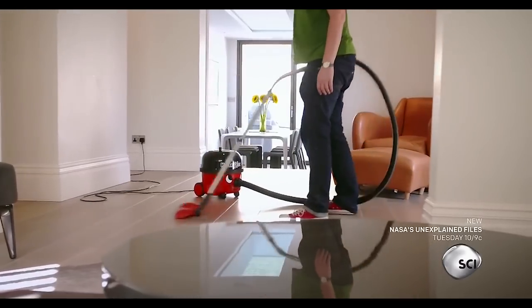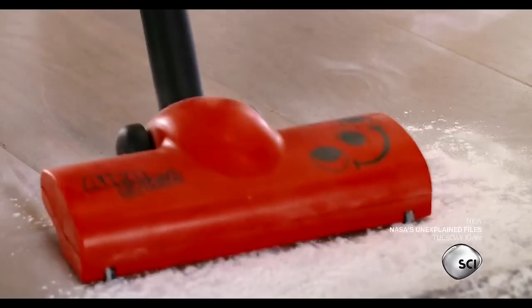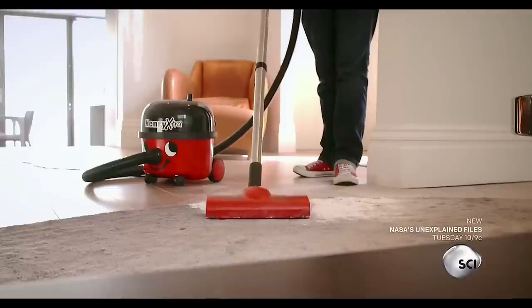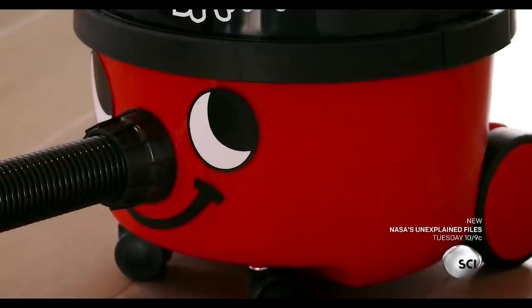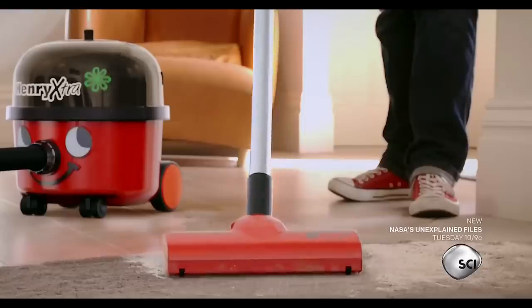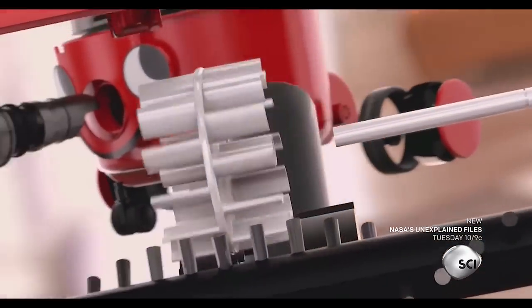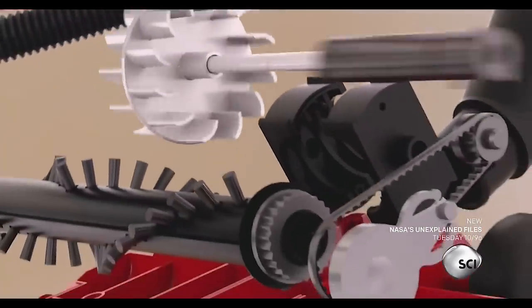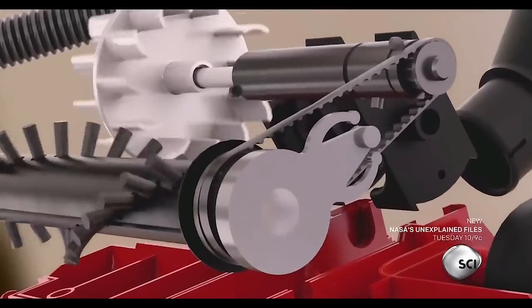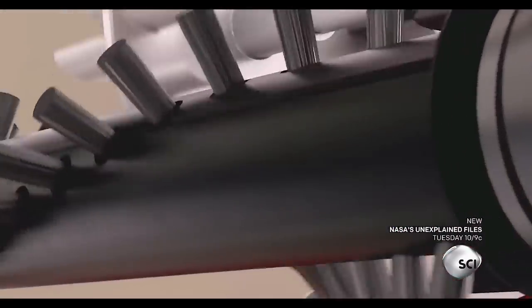This cleaner sucks fine. The motor generates a constant 100 mile an hour stream of air that sucks dust up from hard floors. But on a thick pile carpet, even these hurricane force winds won't do the job. So how does the cleaner suck up dust that's ground deep into a woolen pile? Hidden inside the brush head, this machine has a secret weapon: a small turbine whirling in the air flow. A rubber drive belt connects it to a spiral brush, whose bristles kick up even stubborn dust.